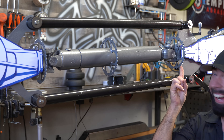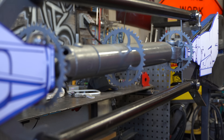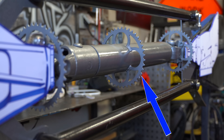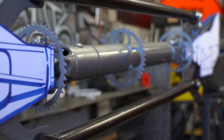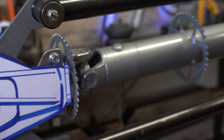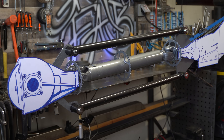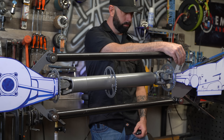On this drive shaft there are three bicycle sprockets — those are noisemakers. They will allow you to hear any variation in speed. One is attached to the transmission tail shaft, another on the center section of the drive shaft, and the last one on the differential. To start, notice our entire drivetrain is in line with no bends. And because of that, there's nothing interesting to see or hear.